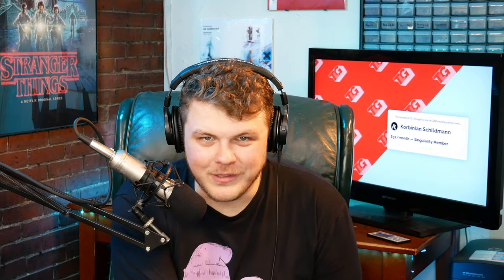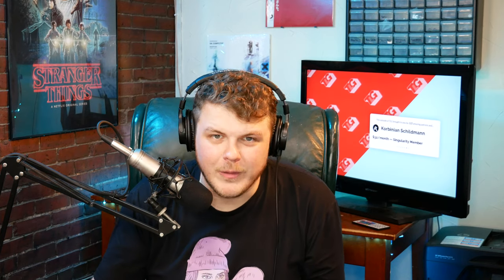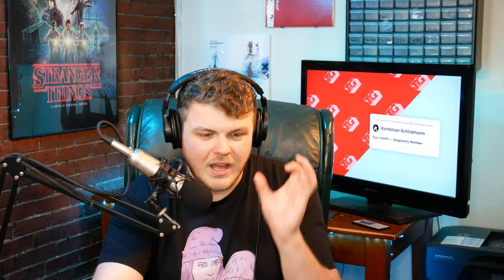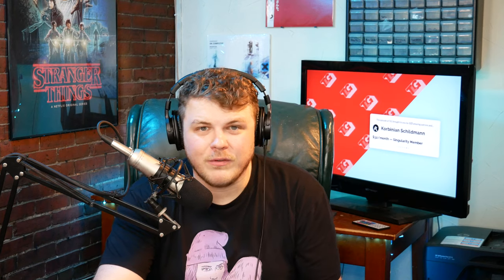So this video is called: Are the Librem 5 Specs a Disappointment? The answer is an unequivocal no, and I'm going to go into why. One of the things I find so awesome about this device is that it's user-serviceable — they treat you like you're an adult. You can actually change the battery yourself. It's so revolutionary, this concept. I have very little respect for companies that build the battery in and make it very difficult to change on your own. But that's not the only modular piece — the baseband is also completely replaceable. You can pull it out and replace it with a different baseband controller if you want. It exists on an M.2 bus, so you're able to just pull this chip out and put in a different one. There aren't other phones on the market that let you do that.